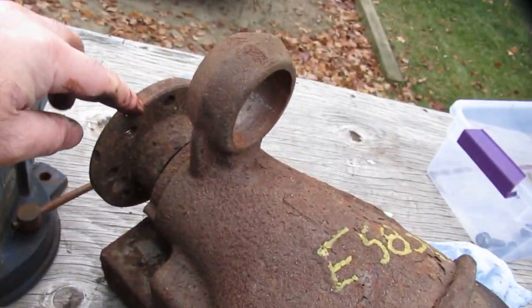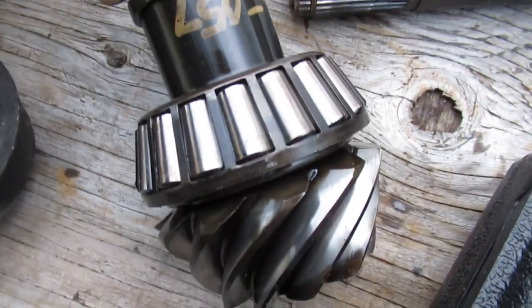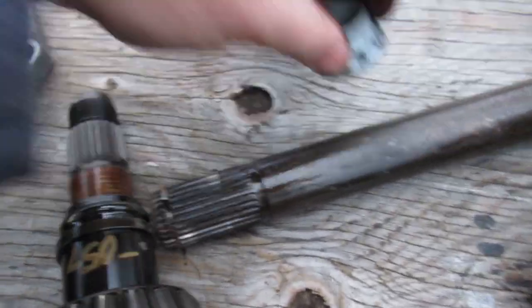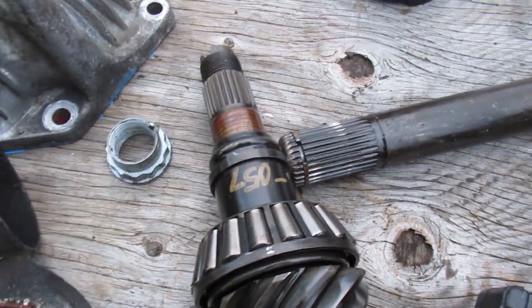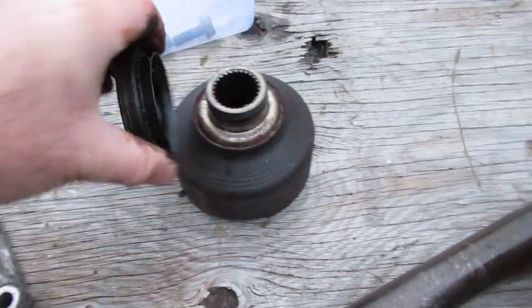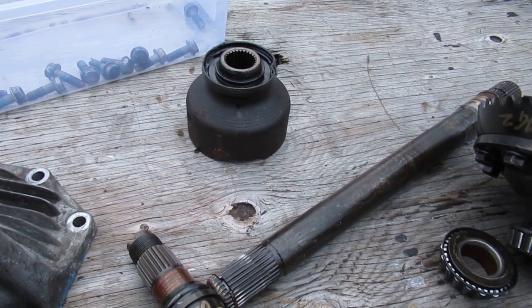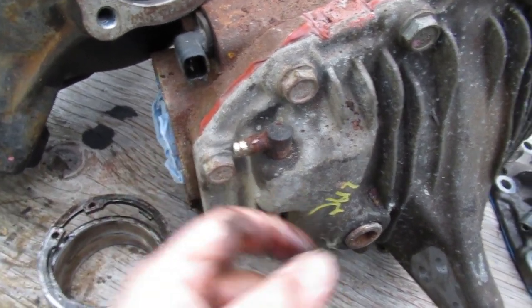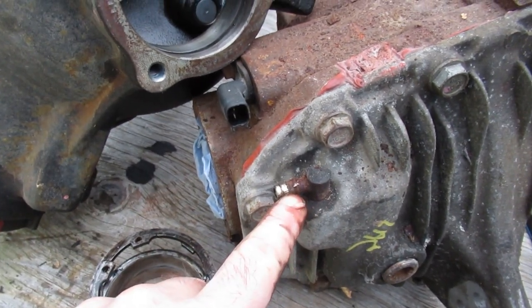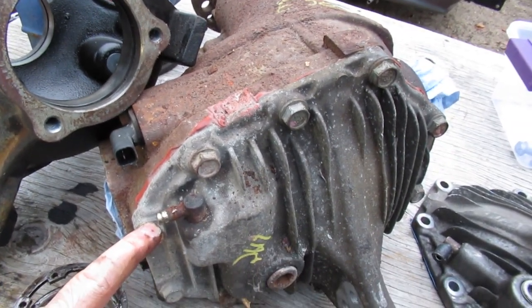When I change this, I have to be mindful of the crush washer right here for setting your preload on that bearing. Be very careful - don't just whale on it as hard as you can, because you'll ruin the alignment. Honestly, I take it to a garage when I need these changed. I just got my rear pinion sealed at the garage this week - cost me an hour of labor but I couldn't have done it in an hour myself and they did it right. If you ever blow out a seal, always take your vent line off and either replace it or blow it out with compressed air. This line goes up to your right fender well in the engine bay. Clean that out, because normally when you blow a seal it's because the body of the differential is pressurizing - and that's the cause of it.